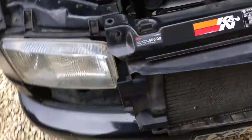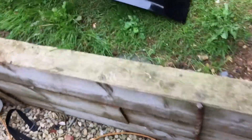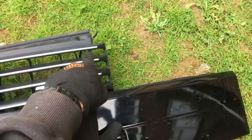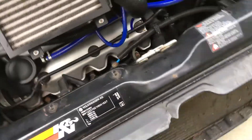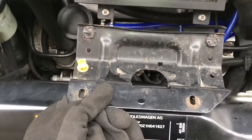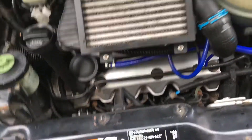First of all, preparation. Basically take out these screws here, come under here and take out those screws. You might have a clip at the top here — I've got zip ties. The front panel unplugs. Then undo this bolt and this bolt there. You might have a little bracket here. Mine have actually come off so I just took the little bracket off. I can leave all the intercooler assembly in place.